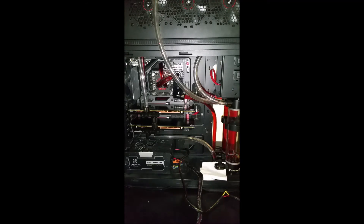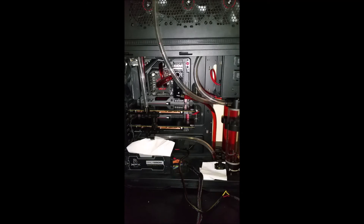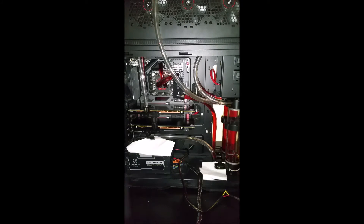We've got a stopper underneath it now. We're going to put a paper towel underneath to catch any residual dripping, and also underneath our video card — sorry about the little flurries from the paper towel creating a bit of dust; it'll calm down in a few seconds. We're going to go ahead and start filling up this loop. To get a continuous flow it looks like we'll have to fill it almost all the way to the top, so we'll fill this one up a little more than the last one. This loop feeds just into the two video cards through the radiator and back down.